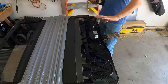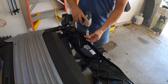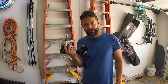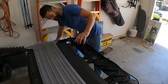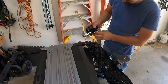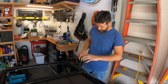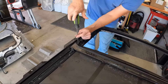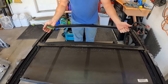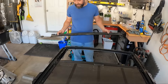We flipped this over because there are three bolts here to take out — this is a T20. I'm using a drill gun to take them out, but I will not be using it to put them back in — this is going into plastic. Metal screws and plastic is a bad combo when driving them in, but it's great for taking them out. That comes out nice and easy. Check the gears to make sure they're not stripped — those actually all look pretty good. We're back on top now. There are two Phillips screws here; there's a little lip where one side goes into a groove and the other side clips in. Pay attention to this because when you put it back you'll know how it goes.